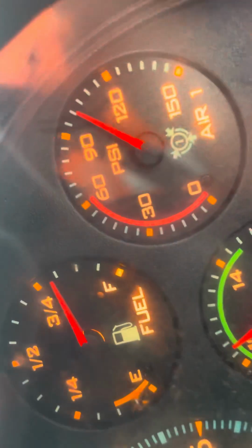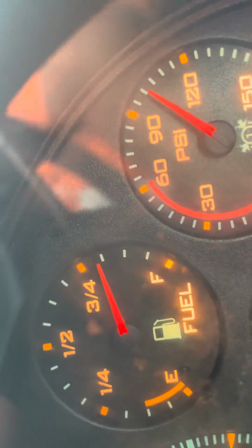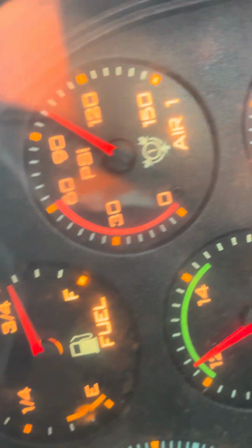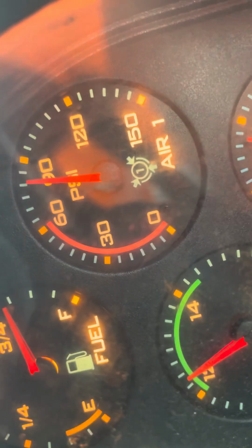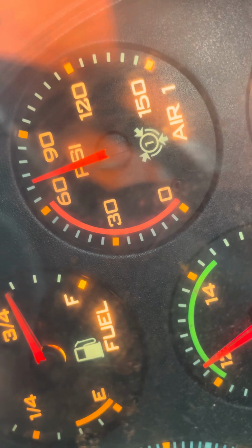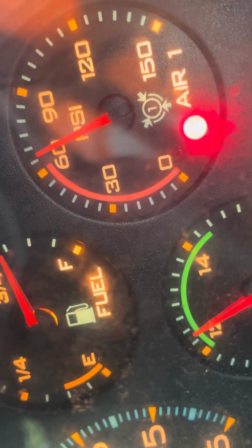Now you release the brakes. The next test is going to be my low warning light and buzzer. I'm gonna carefully fan the brakes, the service brakes, and my low warning light and buzzer should activate at or before 55 psi. My low warning light and buzzer are working properly. They activated at 66 psi.